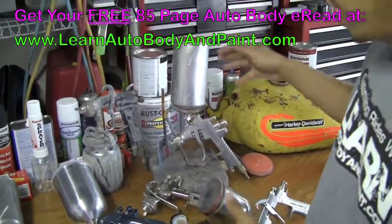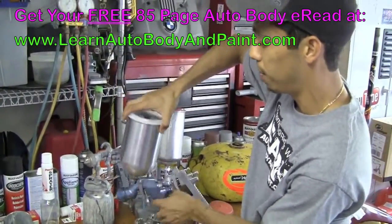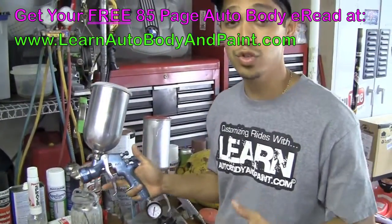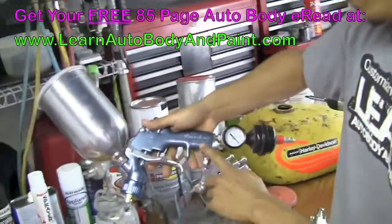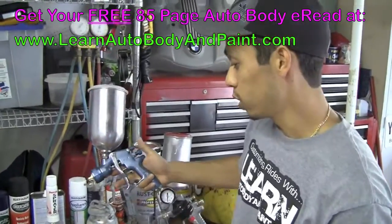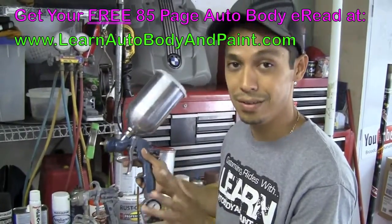As we get into newer technologies, something called high volume, low pressure had evolved. These guns are gravity fed, which means you put your materials in up top and the gravity feeds it down into the neck and then you can spray out. Gravity feed guns are the most common ones and what I recommend you should get started with for your projects. This one is a Finish Line series by Devilbiss. I paid about $160 for this setup — not a bad gun, it's mid class. It's not top of the line, it's not the crappiest brand, but it works pretty well. When painting base coat, clear coat, or enamels, you want to use at least a 1.3 to 1.4 nozzle size tip.